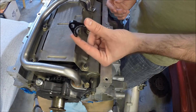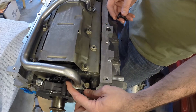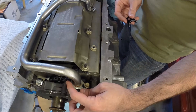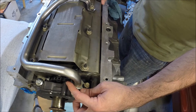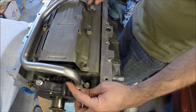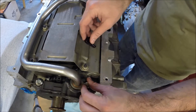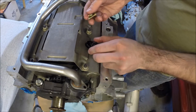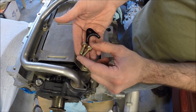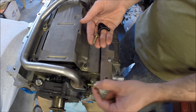For a few bucks, I think that's a worthwhile upgrade. These two bolts get installed at 106 inch-pounds, which is essentially 9 foot-pounds, and then the support leg for the other end of the pickup tube gets the nut torqued to 18 foot-pounds. The nice thing about the Improved Racing piece is they include two new bolts — one for this side, and one to replace the original one.